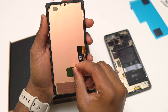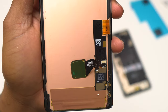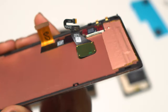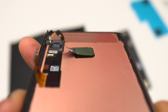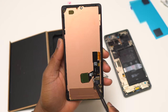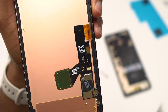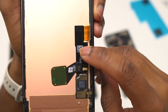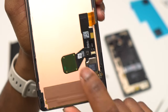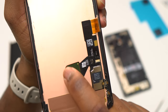The installation of the fingerprint sensor is easy — place it in the same area where you removed it from. I've done a good job with the placement, so I placed the fingerprint sensor on that area without pressing it in yet, checking all angles to confirm the correct position. I connected the fingerprint flex cable first, then applied a little bit of pressure on the whole fingerprint sensor. Now we need to test the screen and fingerprint sensor before sealing the device.